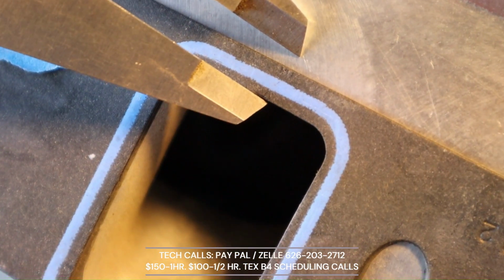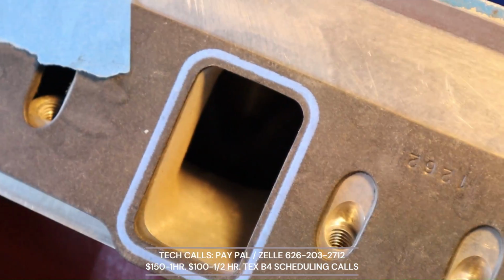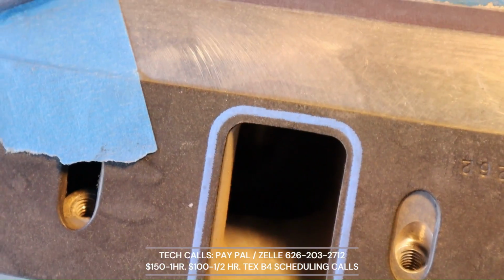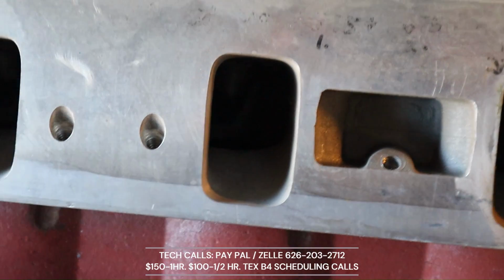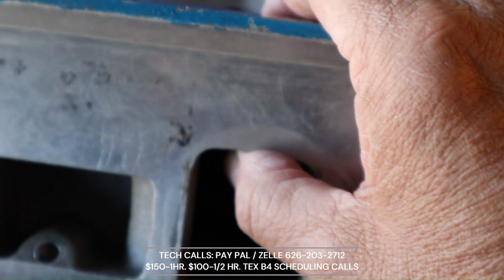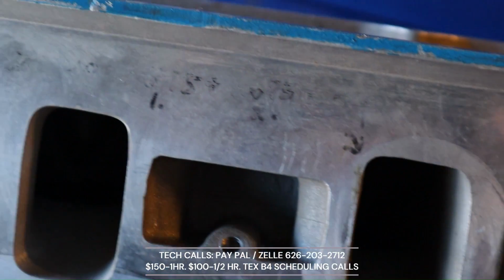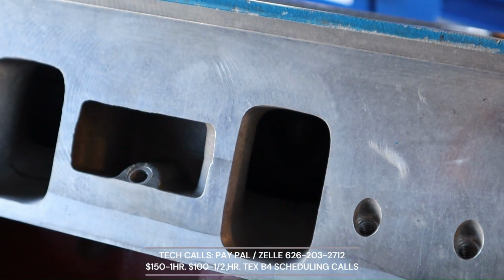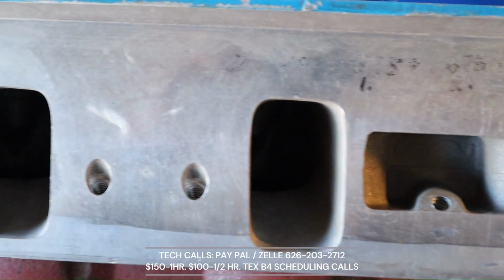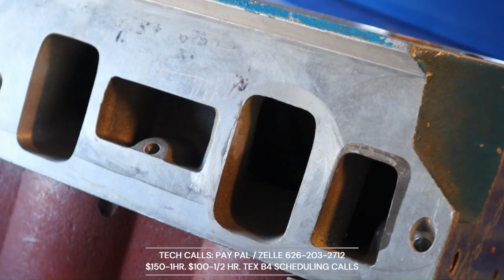And if you would have run a thicker intake gasket, it would have brought it up some more, perhaps another 100 thousandths or close to that. That's what I like with the TFS R. Look at the distance and how your 700s, 3/4 of an inch thickness here to the top of the port. So you could really move that up big time. Okay, so that is impressive.